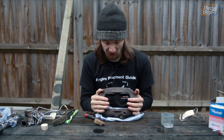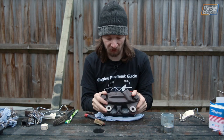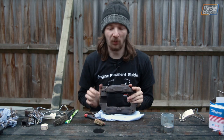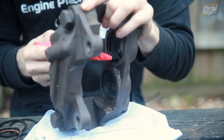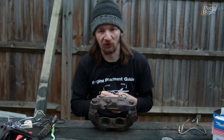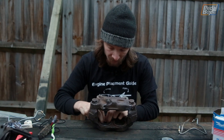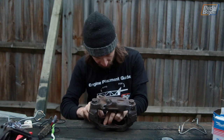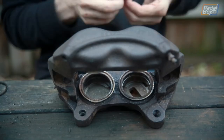We're mostly done with our clean up now. We've gunked everything down pretty good and brushed around the outside of the calipers with some phosphoric acid to try and take most of the rust off. All there's left to do is pop these seals out, clean the bores out a little more once the rubber's out of the way, and then we'll be done. The sun's running away on us pretty quickly, so the last thing we're going to do tonight is put these inner seals back into the calipers. I've already done the other caliper and it turns out these are actually super easy — they basically just fall into place, which I really didn't expect. I thought they'd be a nightmare.